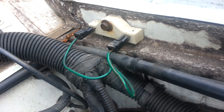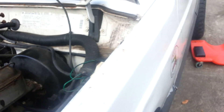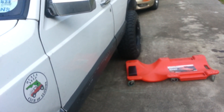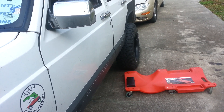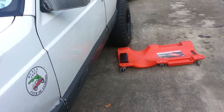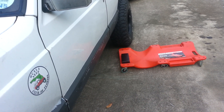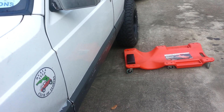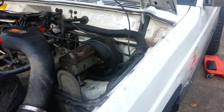I then unplugged the pigtail at the fuel pump to check voltages, and I wasn't getting the voltages I believed I was supposed to. I had my wife help me by turning the key on. From what I've been reading, you're supposed to get 12 volts at initial key turn-on and then it's supposed to drop down to six. But when she would turn the key on, it would just be six and stay at six — that's it.